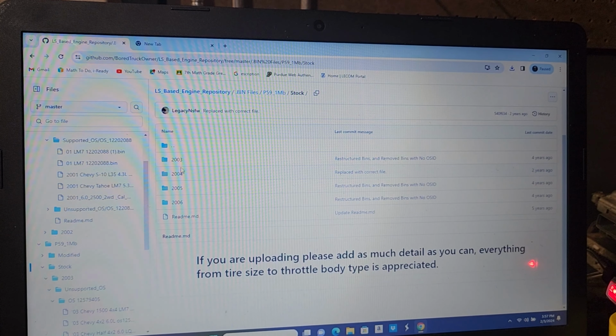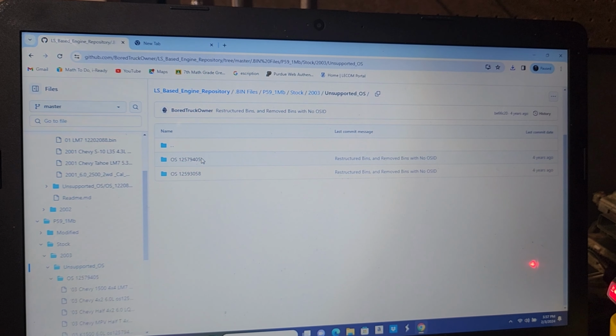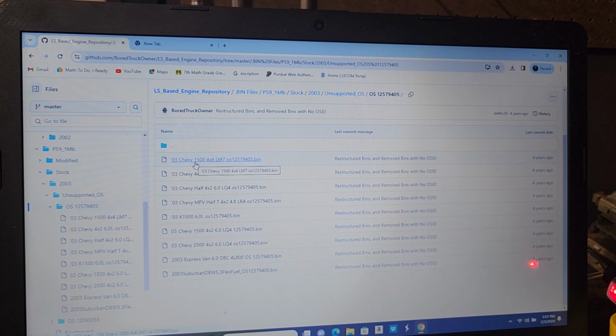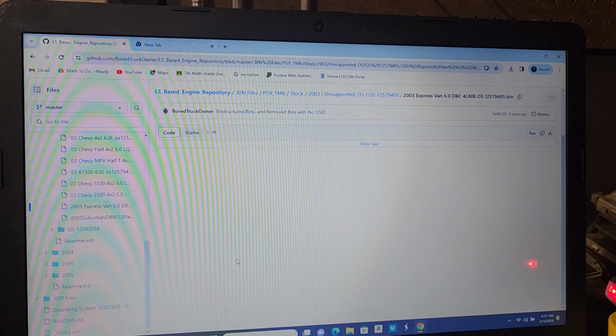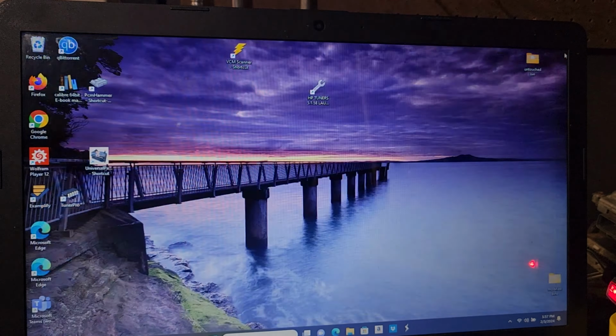But I just kind of want to show you, I know the video kind of took a turn, but I want to show you guys how to check these files before you flash them to your actual PCM. And we're going to take this one right here. Remember the 2003 Express Van, the 6.0, even though it's drive-by cable, it don't matter. We're only after this right here, the 4L80E. So we're going to click it, and then we're going to hit download. It's right here in the right-hand corner, download raw file. And they both downloaded that fast. We're going to close our browser down because we don't need it anymore.